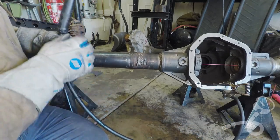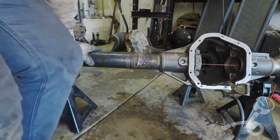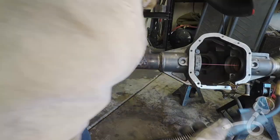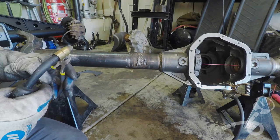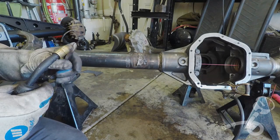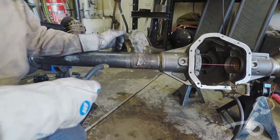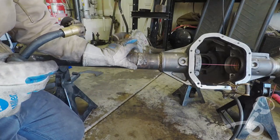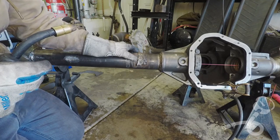So I think I'm gonna step up my game and go ahead and add more filler, because the more filler you have, maybe the more it'll contract. I let the welder take a little bit of a break, and now we're going to hit it with the proper wire speed, except we'll be running over these old towel bits. And I'm gonna clock the welds up. I've got them here, but I'm gonna start running them here. I'm gonna clock them up 10 or 20 degrees.